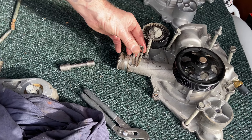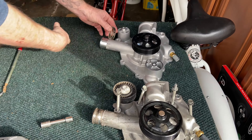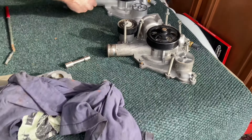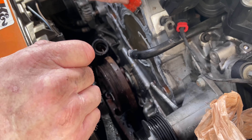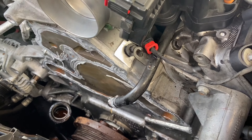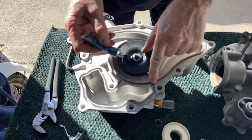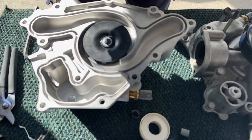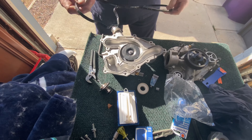When you take off the hose, move this up here and pull the hose off. Put this over here and move it up in this area. But when you put the hose on, you just gotta bring it back down. Transfer the bolts over — I'm taking this pulley off and putting it here. I'm gonna take a razor blade and scrape off any old sealant on your car. The guy who did this one before caked it on. Get some of this right here — made for a water pump. Just lay a bead along this track, and then I'll put the gasket on top of it. Here's the gasket that comes with the water pump — line it up to where it matches.